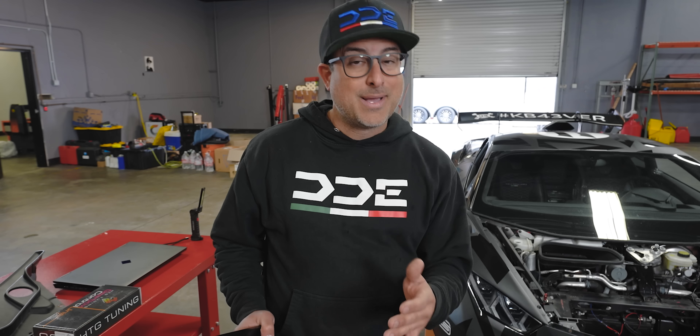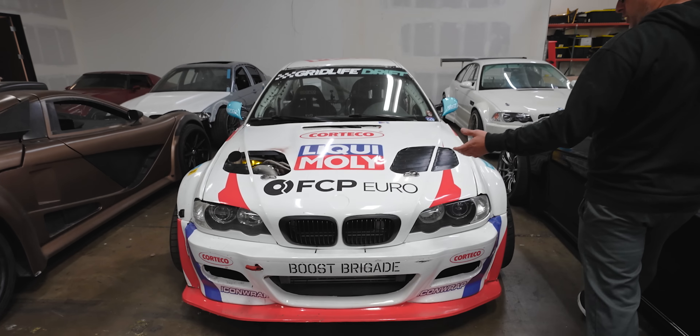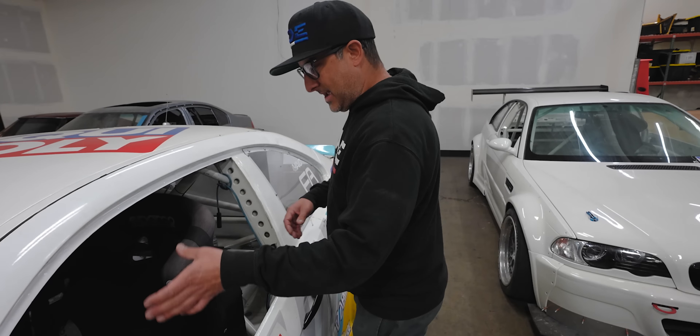We don't want to take away factory comforts and safety systems like the ABS — we want to leave those in but also have it work like a proper drift car. A proper drift car is not controlled just by throttle; you need these other tools to control the car down to the last millimeter, to really put it in the spot you want. My pro competition car has a sequential shift lever, and the real difference is a sequential transmission — the linkage connects directly to the shifter with just heim joints and a piece of rod, giving you that direct feel with every pull.